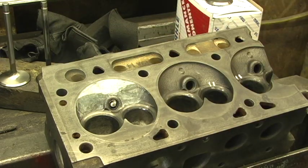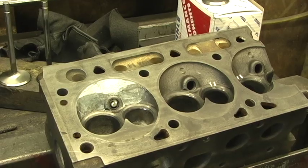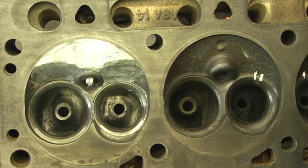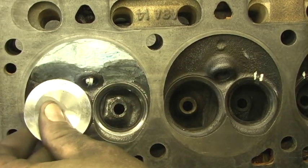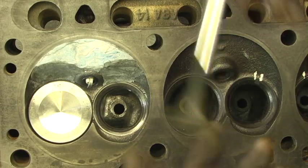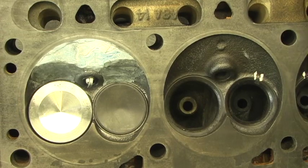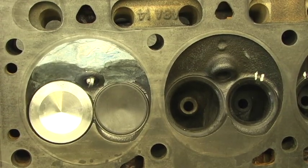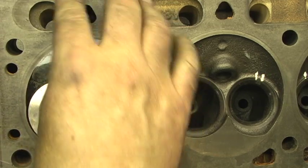Although it's a rough clay mock-up, it's going to be very approximate and close. Here we are more in line with being dead nuts up on it. This is a 1.890 valve — the performance valve. This is a 1.60, which will actually be 1.59. You can see with the valve coming out, there's plenty of area of unshroud. It's hitting it and banking off.